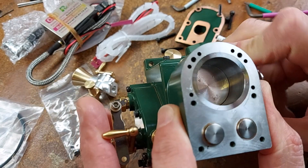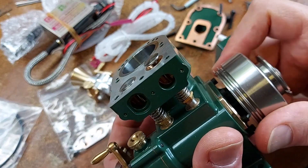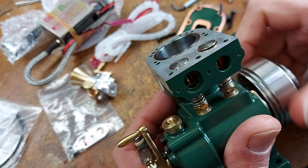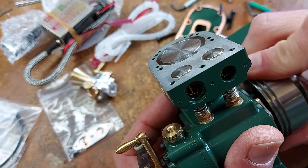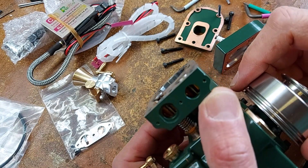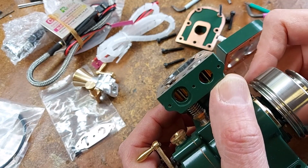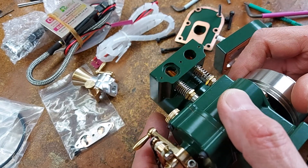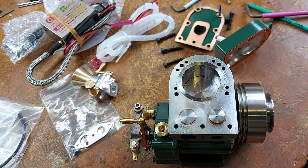There's just a tiny bit of dirt on there, but not much. Now we can see the piston — that's the exhaust valve opening, intake valve opening. Now exhaust closed, intake open — lovely, isn't it. You can just see the valve guides there, and the seats, all made in one part. Right, let's put that back on and tighten that all up.